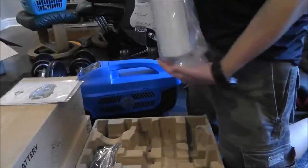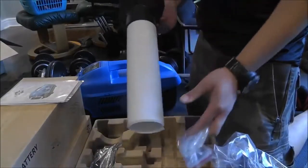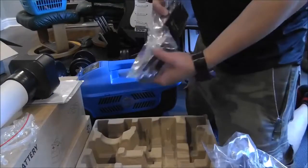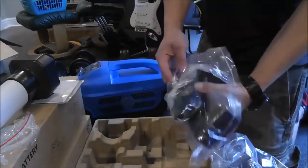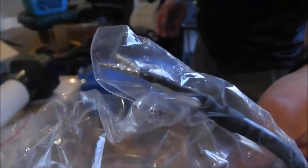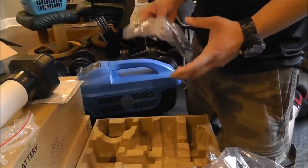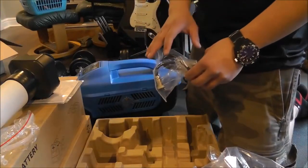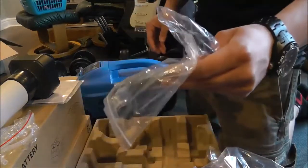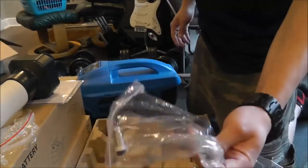It's very important to keep hold of your exhaust hose and your drain hose for indoor use, because without exhausting that hot air, you're just heating up whatever space you're in. Here is your wall power brick with the wall adapter, and here's your 12-volt cable with extended open ends for you to attach to whatever connection you want. Obviously it would be best if they had left a cigarette lighter connection on there, but this could potentially blow a fuse in a lot of different cars depending on how many amps your cigarette lighter circuit is, so it's understandable.